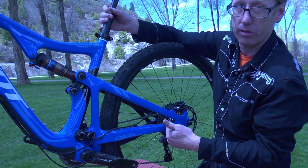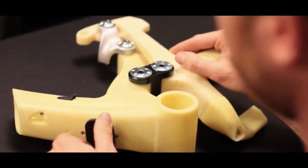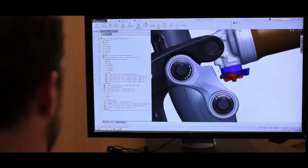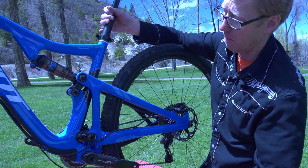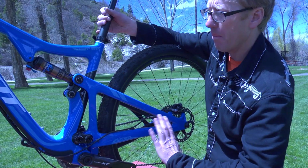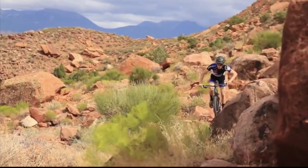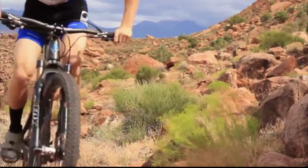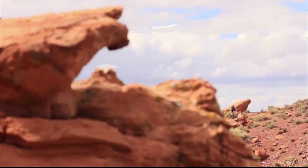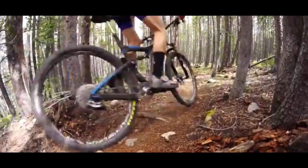It's called a rearward wheel path before it really gets into the suspension. And how Pivot has designed these is to feel differently depending on what the impact is. The beginning small bump, you barely even notice the suspension is working, yet it is. In the middle of the suspension, meaning you're using up a bit of this travel, they start to feel really, really soft, really supple, and then they ramp back up at the end so you don't bottom it out. It's a non-linear path, if you want to get technical, in their suspension curve.